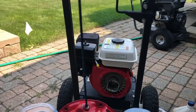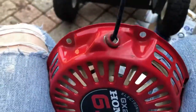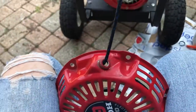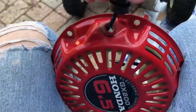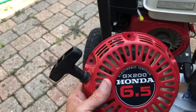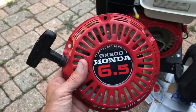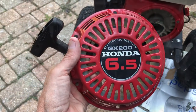Fresh rope in the starter - now it's got plenty of length to it. Oops, maybe I got too much rope on there. I think I'll cut about 6 inches off because it's hanging when it tries to retract. I always put as much rope in as I can possibly fit and then wind the spring just tight enough to retract it, so you're not overstretching the spring in the center. Alright, let me fix that - nothing's easy.